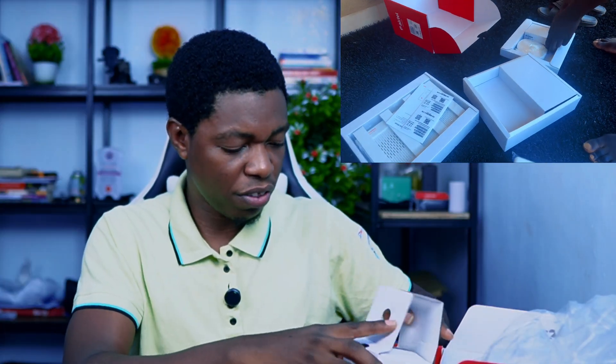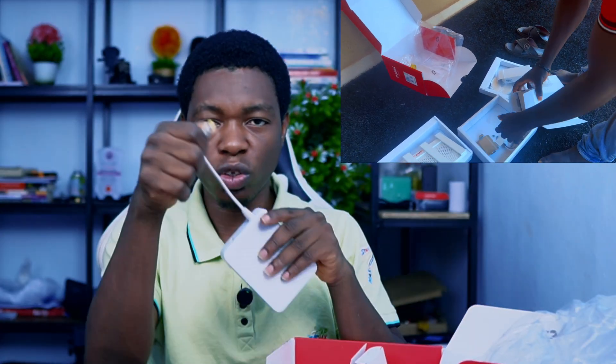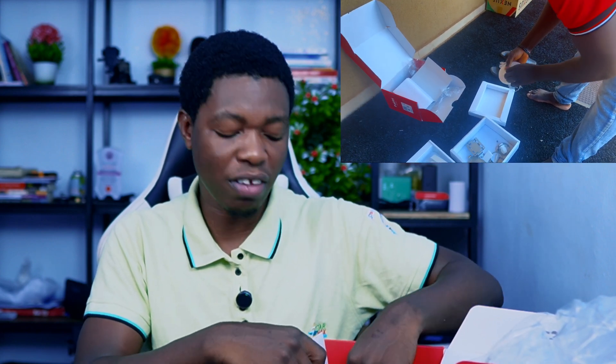There's also a manual and an extra cable. The kit includes an ethernet cable, the indoor unit (the router), the outdoor unit, and a long cable connecting the indoor unit to the outdoor unit. This serves as a PoE — power over ethernet — because only the indoor unit is powered. You plug the adapter into the power source, plug it into the router, and the ethernet cable carries both data and power out to the outdoor unit.